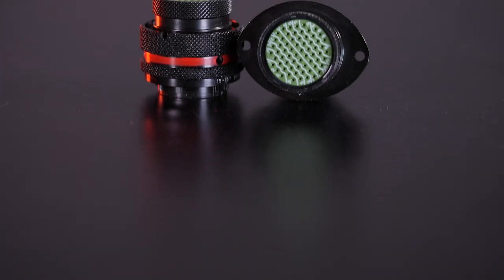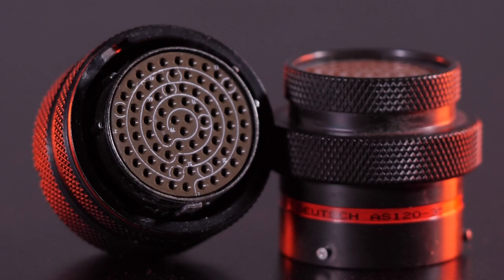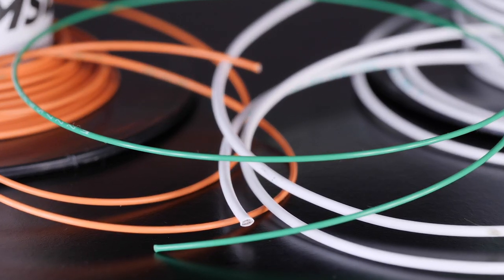The idea of potting our connector isn't going to work because we still need to be able to disconnect that harness. The ideal solution would be to replace that factory bulkhead connector with something like an Autosport connector. These are nice and reliable and made purposely to put up with the vibration and harshness of a motorsport application. However, there are a couple of problems. First, these are pretty expensive. They also aren't easy to work with if we aren't using Tefzel wire — the insulation on a factory wire is much thicker than on Tefzel mil-spec wire, making it very difficult to insert regular factory harness wire into an Autosport connector. That makes it just about impossible to work within our application.